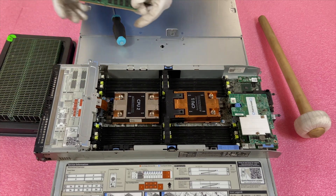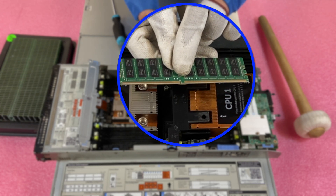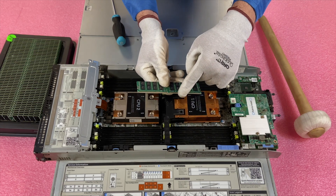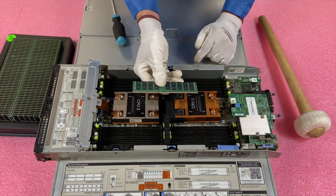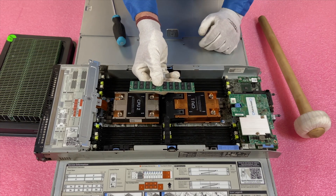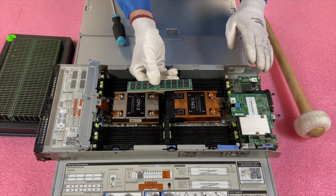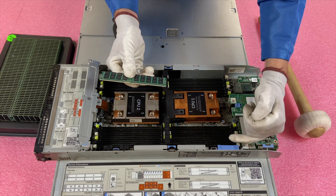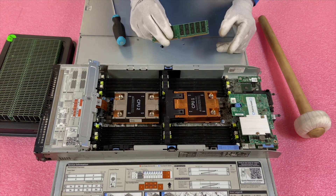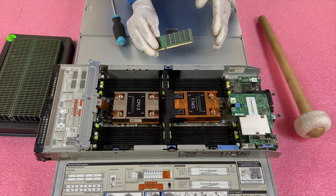When you look at the memory module itself, there is a notch in the middle known as a key, and it is not perfectly centered. If you do not line this up properly in the DIMM slot, you could damage the module itself or the DIMM slot — potentially rendering the whole channel useless, or even requiring you to replace the whole motherboard. None of these are issues you want from user error. The time it normally happens is when you're in a groove loading one side and you move to the other — it actually flip-flops. When loading one side the key faces one way, and the other side it's reversed. It's a very common user error and I've seen people bust DIMMs and DIMM slots because of it.